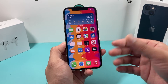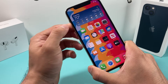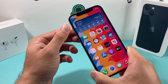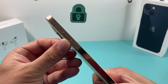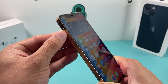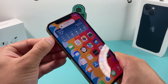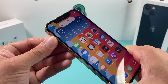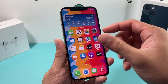So the first thing you want to do before we start the whole troubleshooting process is actually check if it's a hardware issue and if it's a motor-related issue. Built into your iPhone is going to be a motor. The way to check if the motor isn't broken or damaged internally is to check it with the silent button on your left-hand side. Here we have iPhone 12 Pro. We're going to toggle this on and off, and when you do that, you'll feel that when you silence it, it will shake — that means it's vibrating. If it doesn't vibrate automatically, you can assume for about 95% of the time it's something wrong with the motor.